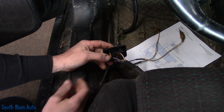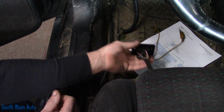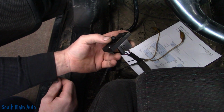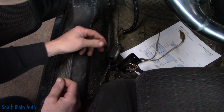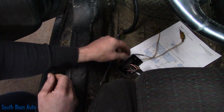But I did notice one little thing. So here's the seat switch. It's on the front of the seat. I can't get you guys the optimal angle. You hear the motor trying to go back, but when I try to go forward, we don't hear squat. Okay? That's a good clue. The clue there being the motor that moves it back also moves it forward.